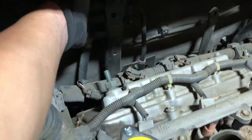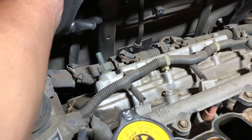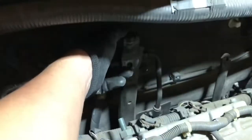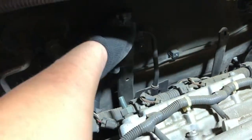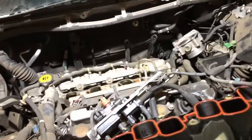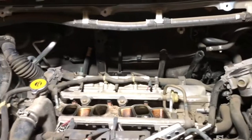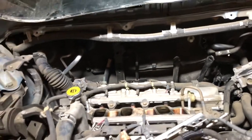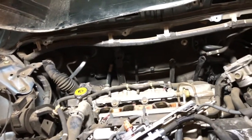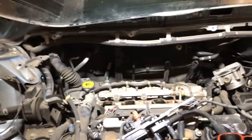The plenum is out, but what's holding it is this bracket — and to make matters worse, the 14mm bolt connected to it is blocked off by a hose. I have no idea what Toyota was thinking. I mean, Toyota engines are great and I love their reliability, but sometimes something so simple can be so difficult to take out.